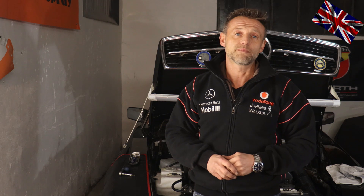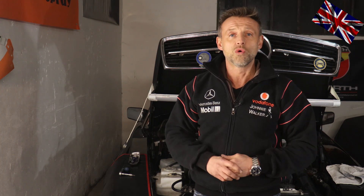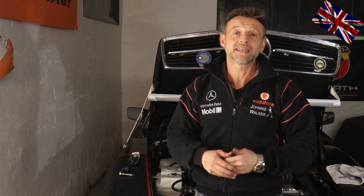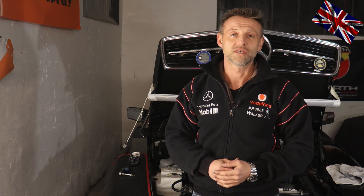Let me hammer away on one fact: use a Bosch component and do not damage the inside of the component — remove it horizontally, not vertically, to prevent damage. We are talking about a 200-euro part. If you have a more modern car, depending on model and year, your cockpit display may show a fault code — just ignore it when the job is completed. Disconnect the battery for at least 20 seconds and the fault code should be gone; otherwise repeat for at least a minute. You'll find the playlist for the K-Jetronic chapter further below in the description. Hope you liked it — hope to see you around soon for the next topic.